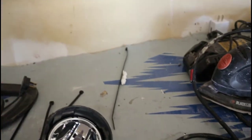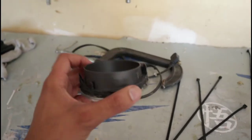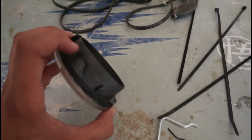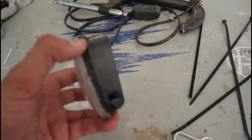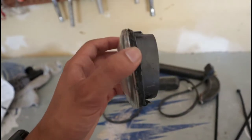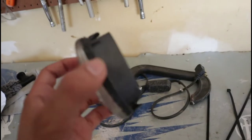The only problem is the halos hit up against the inside of the fog light housing, so I have to take the Dremel to shave some of it down for the halo to actually fit. This is the part of the housing I have to cut — the halo is just hitting up against this section. I'm going to trim a tiny bit back, trim out the part that is wider than the rest, and that should allow the halo to sit in there nice and even.